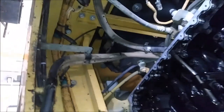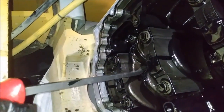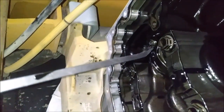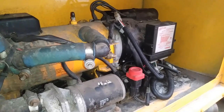This week's Destruction of the Week: we have a C7.1 in an excavator. The 7.1 is way different than a normal C7, and it had a horrible — what sounded like a bottom-end knock. What I was doing here was checking the connecting rods to see if one was not quite tight. And that seems to be quite excessive play there. It had a completely damaged crankshaft and connecting rod. We've got her all buttoned back up and as you can hear, she is definitely running now. Good job.